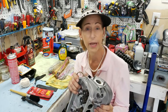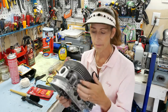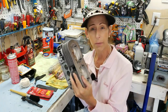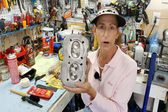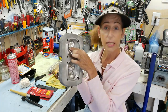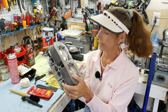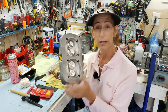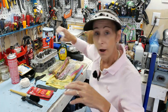So that's what's on tap for today. We're going to pull the other cylinder head off and I've got to clean the pistons and everything else in there. That brings up a point — I kind of broke one of my own rules. I like to inspect parts carefully when they come off the car so that when I take them to the machine shop I have a good idea of what might be wrong. I did not see that crack, which would have been great to point out ahead of time. We may need to replace the head if the crack is really too bad.